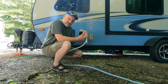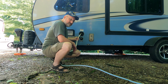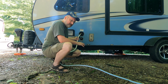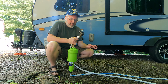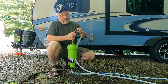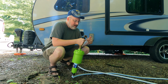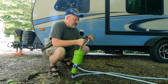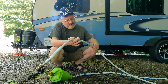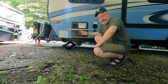I need what I call traveling water — just enough water in the tanks so I can use the sink and flush the toilet while I'm traveling on the road. Disconnect from the city water connection and go straight into the potable water tank; I need a couple of gallons at most. When you wind up your hose and put it away, go ahead and cap your connections so the water that's in the line and filter stays there. There's a risk of getting some backflow but it won't be much, and once you connect back up just do a quick flush from your hose. Use a rag to wipe down the hose to minimize dirt and sand getting inside.